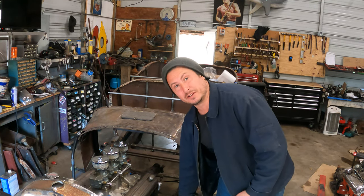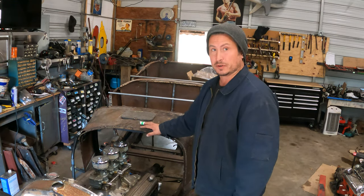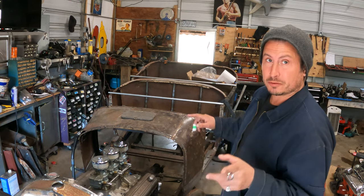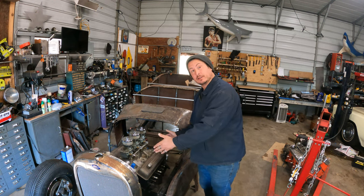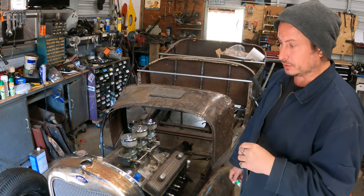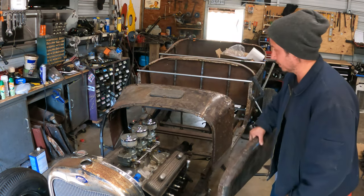Just in case you're brand new here — hi Ryan, welcome to Between the Sharks. It's a 1927 Ford touring body on a 1928 through '31 Model A frame, stock wheelbase. That means we don't have enough room here, so we are going to employ one of the oldest tricks in the hot rod book — nothing new here. We're going to reverse the firewall.